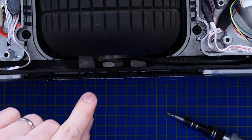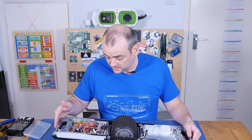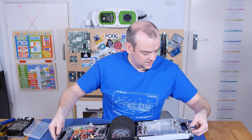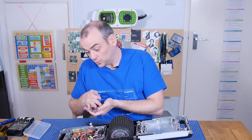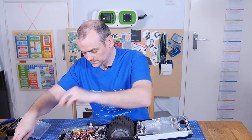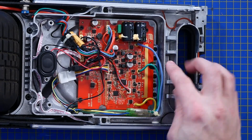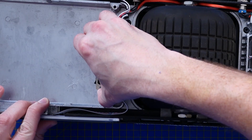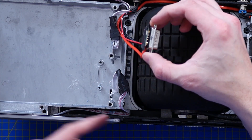I'm going to need the big boy tools at some point because that motor mount is big — like on an M10 thread or something. This is the bottom side, so normally riding the other way up. Lots of LEDs on the way round — they all appear to be normal LEDs, not RGB. One has a smashed lens with surrounding ceramics already gone. It's nice that most of this is on plugs, and they're also using this aluminium frame as a heatsink for all the MOSFETs. A little bit of silastic onto tape — I wonder if they found they didn't get a good bond onto the casting.